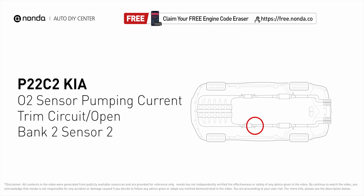It indicates that the engine control module has detected a reference voltage that is not within the range of oxygen sensor number 2 pumping current trim circuit for bank 2.